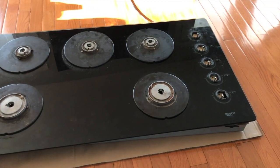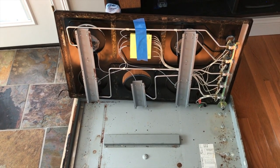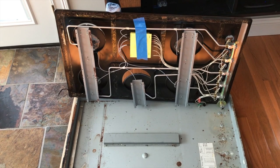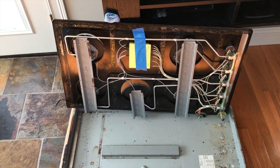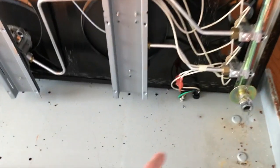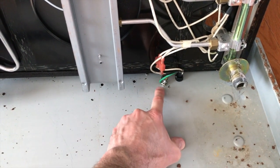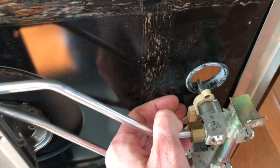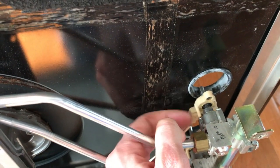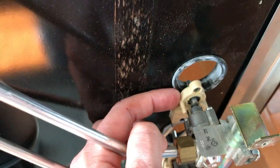From here we'll raise the cooktop and gain access to the bottom side where all those ignition switches are. The cooktop is lifted up and on its side. You can see all the internal parts. That big blue piece of tape is helping support the control module in place so it's not hanging by those cords. Down here you have a ground screw and your power cord — we want to do our best not to harm these connection points. Coming up top, carefully shift this back and this ignition switch comes up and off that little rod.